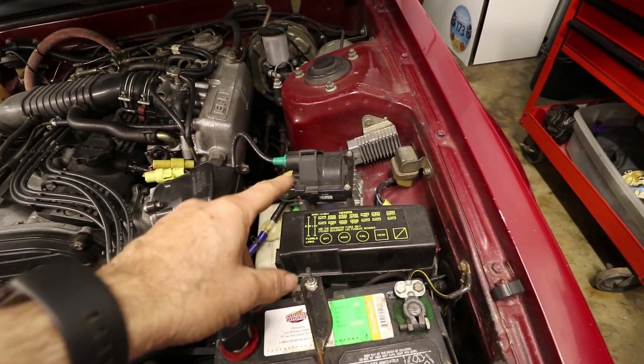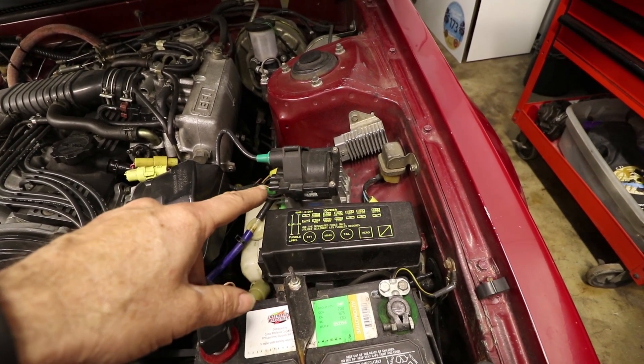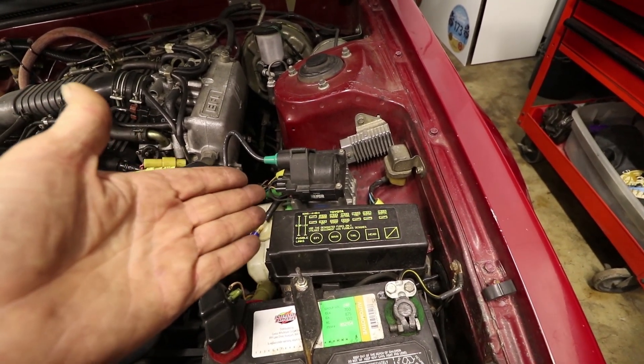Another thing to try is replacing the igniter — the igniters are sometimes problematic in these cars, so it might make sense to try a new one, or another used part since these are no longer available either. If you have any suggestions, leave them in the comments below. I might be trying to overkill this a little bit — it's 80s fuel injection with a narrow-band O2 sensor, doing the best it can for the time period. It's actually driving really smooth. It's just that when I watch that gauge under almost steady-state conditions, it has that little dip, and I can slightly feel it. But the car drives through it just fine — it's pretty minor. If I can make it better, I will. Cheers, see you guys next week.